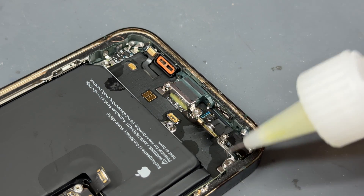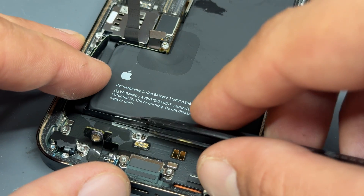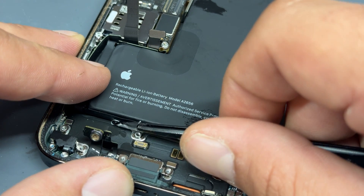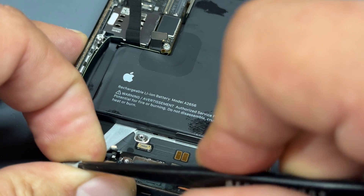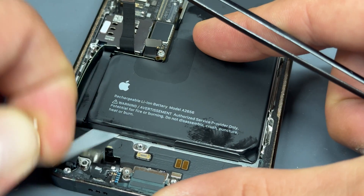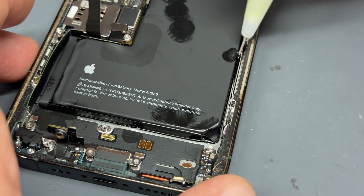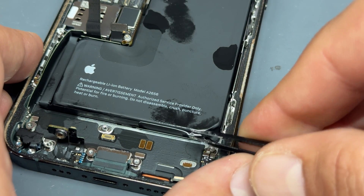The alcohol will soak in and make it a little bit easier to remove. The most frustrating step is that we need to take the battery out. This is five percent skill and 95 percent luck whether you can get the adhesive tabs out in one piece. A little drop of isopropyl alcohol underneath helps, but it's very easy to put too much in as it breaks down the adhesive.